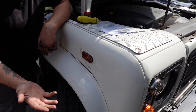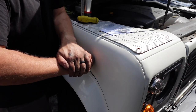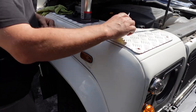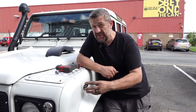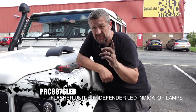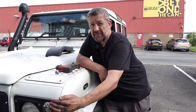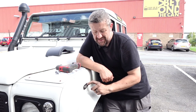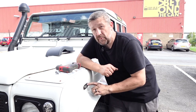On the driver's side, or right-hand side of the vehicle, you actually have to pull the light fitting backwards to release it — just slide that back, then use your screwdriver and it pops out. It's important to mention: if you're fitting LED side indicators, because they're LED and don't offer resistance, you're going to need a suitable flasher relay. I'll put the link in the description. The reason it works straight away on ours is because we already fitted LED side lights which came with the flasher unit included — it's plug and play for us. But if you're just replacing the side repeaters, get yourself a suitable LED flasher relay.